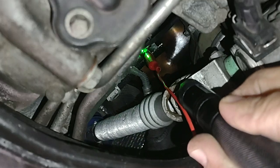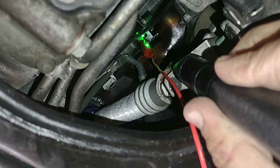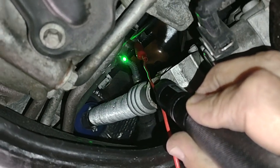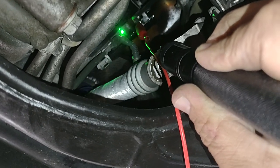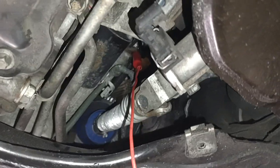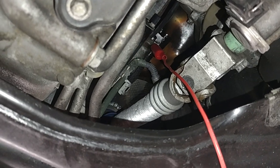The other wire — you can see my red probe with the alligator clip connected — this is the switch signal wire. When you turn the ignition all the way to the start position, this wire gets power to the solenoid, which activates the fork into the armature and moves the gear into the flywheel in order for the vehicle to start.